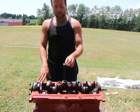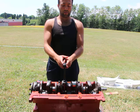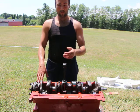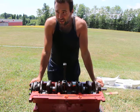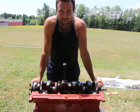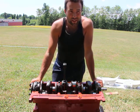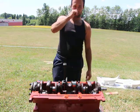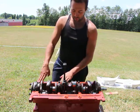At this point there would be two options: either I machine the connecting rods themselves and make the tops narrower, or I machine the pistons. The pistons are much easier to find than connecting rods. It's highly unlikely you're going to find somebody selling full sets of connecting rods, and if you do find them, it's certainly going to be quite expensive.